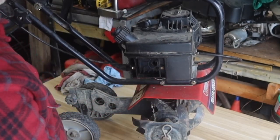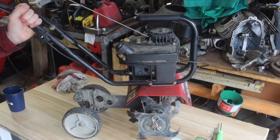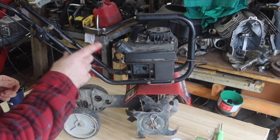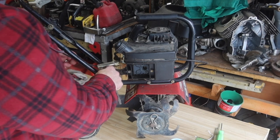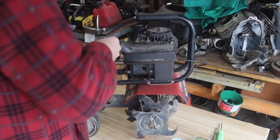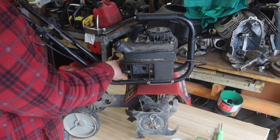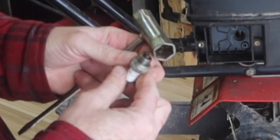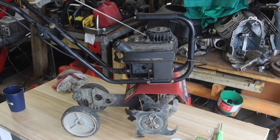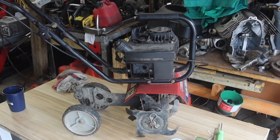Fuel line is hard as a rock, so it probably wouldn't have worked anyway. It feels like a ton of compression. Here's the trick though — does the compression go away when I pull out the spark plug? Because if you still have tons of compression after pulling out the spark plug, that means it's not really compression and it's scored. The plug doesn't look terrible, it doesn't have a whole lot of stuff on it. Definitely a lot less compression that way.